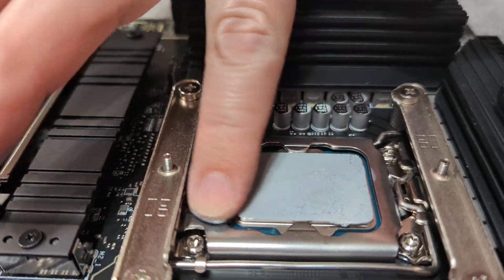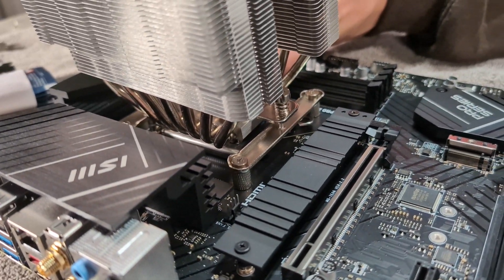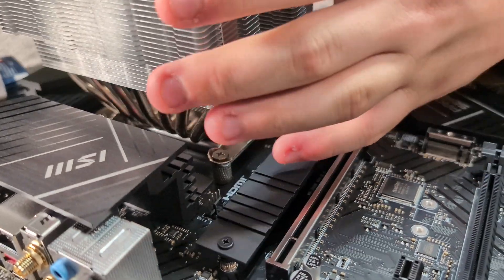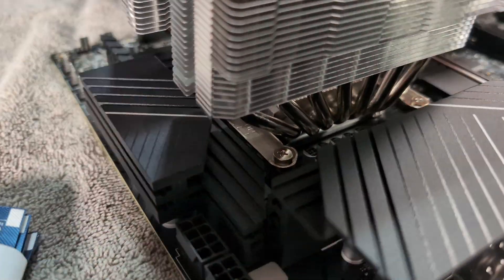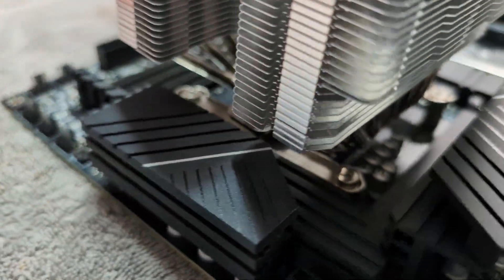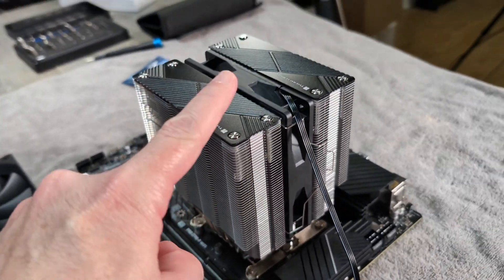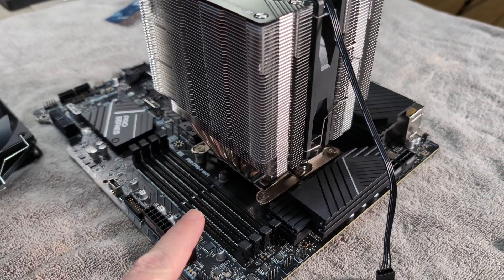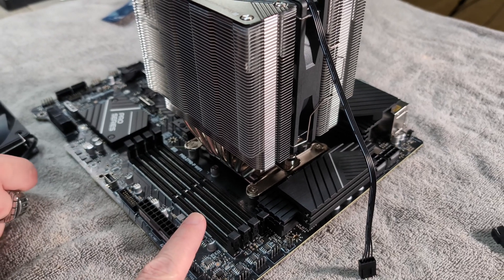Just like a thin coat, but not too thin. Let's get that on there. You don't want to move it around too much. So probably before you put the last fan on — you've got the fan on the cooler in the middle — do verify that you dry fit it, put it up there, and see if you can put the memory chips in.